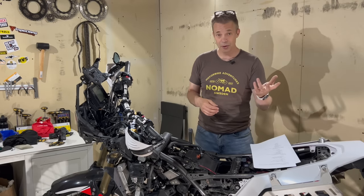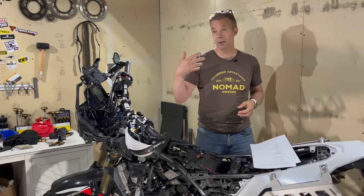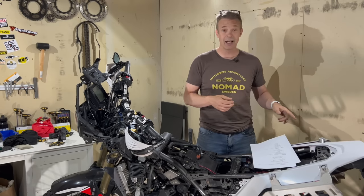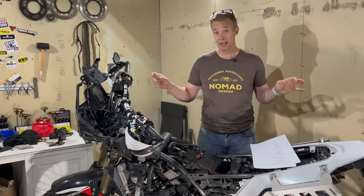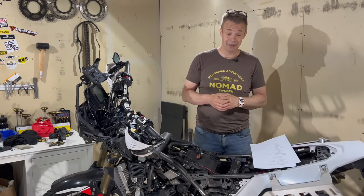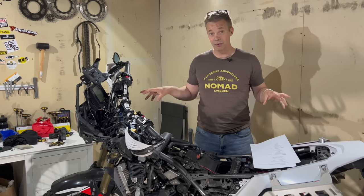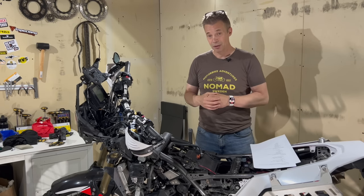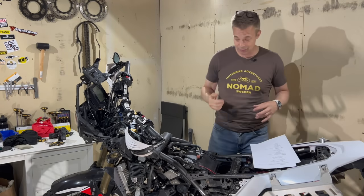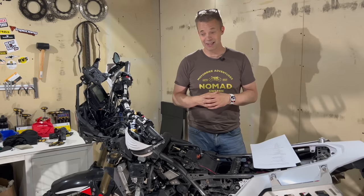So I had those for the next over 20,000 kilometers, and when I reached 30,000 kilometers, I noticed the backside of the sintered pads had run my brake discs down under specifications. So now I had to change brake discs, and that's quite costly, 300 euros for the three discs on the bike. So I changed that and went back to the organic pads. It's easier and cheaper to change the pads than the discs.